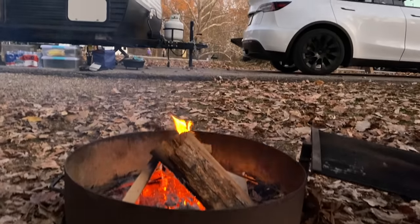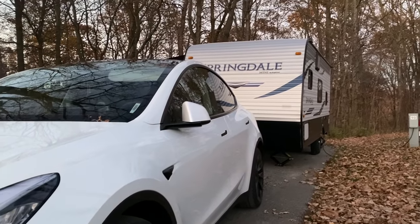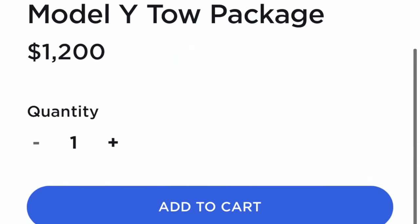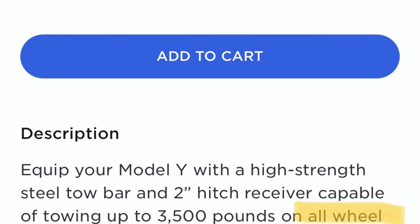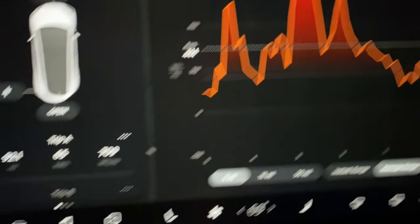We had a great night's sleep in the camper. This is a Springdale 1800BH — about 3,200 pounds dry. We are not towing this with any water or any fluids in it; it's literally just the trailer and our essentials. We are absolutely at the max towing of this vehicle, which is 3,500 pounds. For those of you who are worried, the 20-inch induction wheels were originally rated at much less, like 2,300 pounds, but Tesla did reverse that and all wheels now tow 3,500 pounds in the Tesla Model Y. We did get the hitch installed on Wednesday, and yesterday was Friday, so we hit the road and did about 704 watt-hour per mile average for the whole trip.